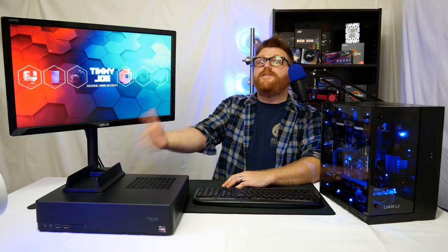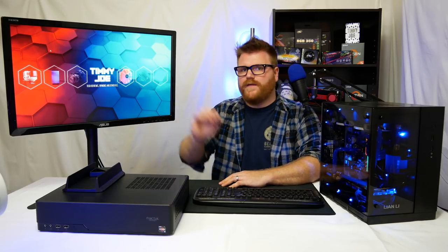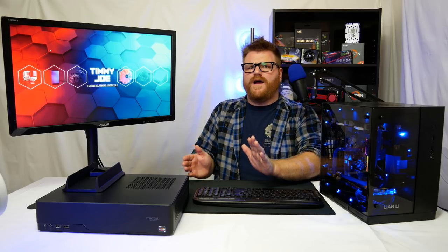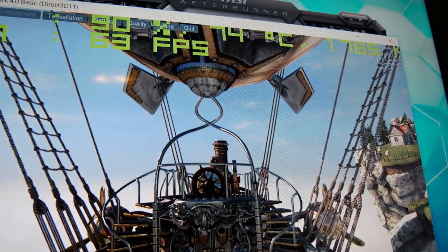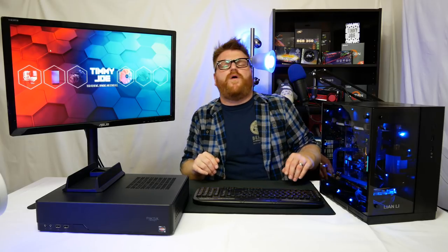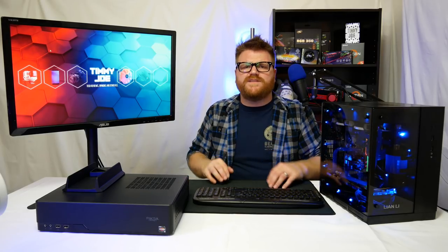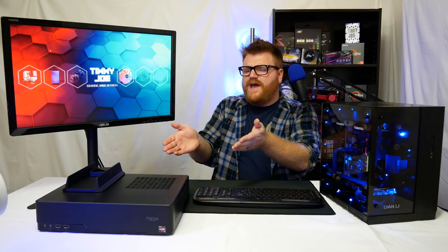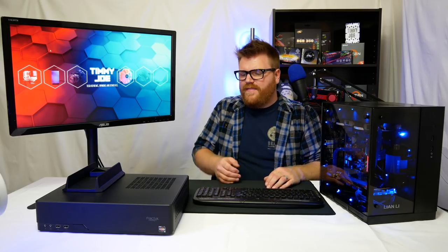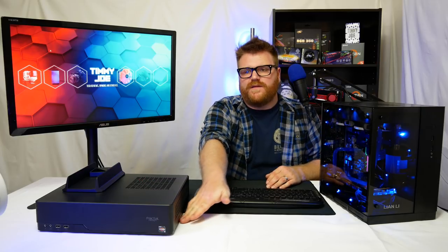And the 1050 Ti Strix from Asus worked perfectly in it. If you set it up properly, you wouldn't even have the fans going very loud in it, as you can see here. Fan noise, barely even a problem. With all the settings cranked and the graphics card overclocked in Unigine Heaven, at around 70 degrees it started to kick the fan up to near 60-70 percent, and that was with this thing down where the airflow is limited underneath it. If you prop it up sideways, you'd never hear the fan in it. That's how good it works.